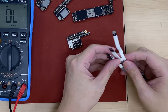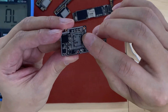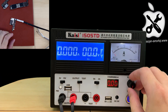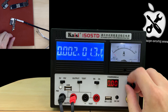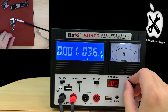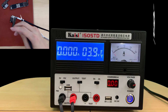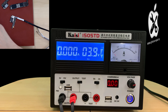The second method of checking the power IC without the CPU: the first scenario was that there would be a current flow in and then it drops back — that's the first symptom showing the power IC is working. The second method is that you will get 1.8V power at the power button test point.